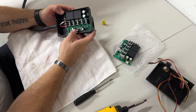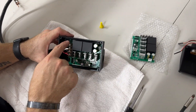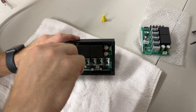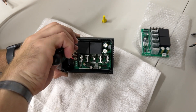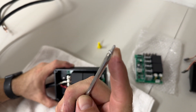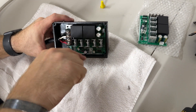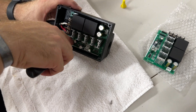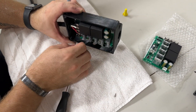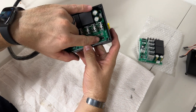To remove the control board, there are two screws. Take your smaller Phillips one screwdriver and loosen this screw — what I usually do is put my finger on the end so it doesn't fall out when I pull it out. Set that to the side, then come over to the other screw and do the same thing.